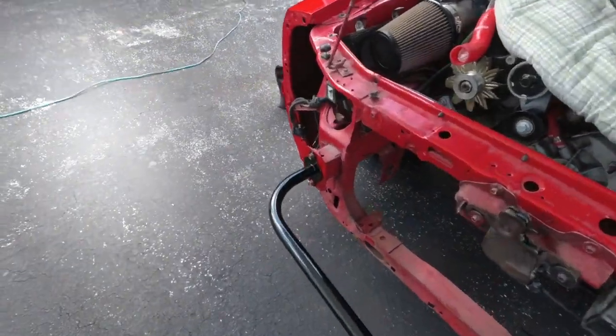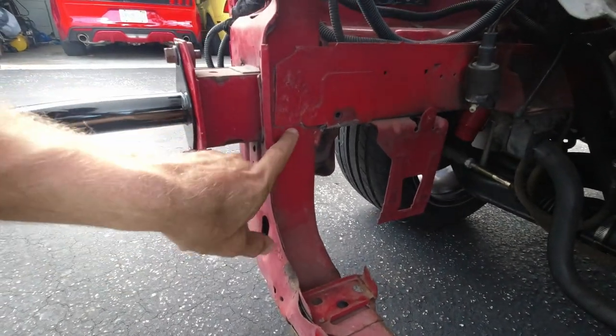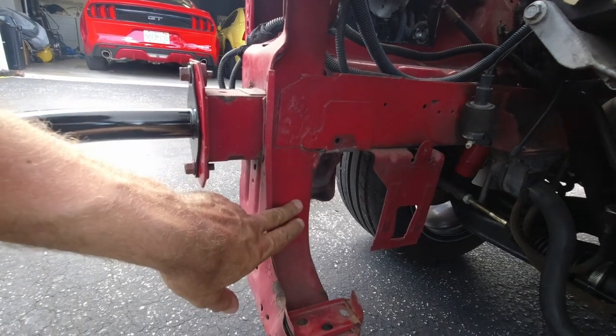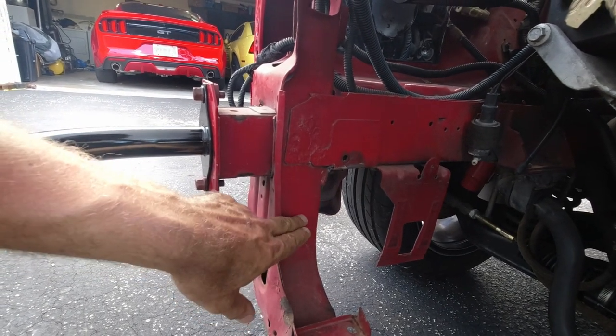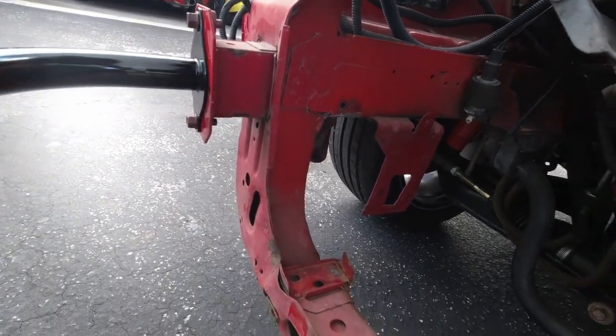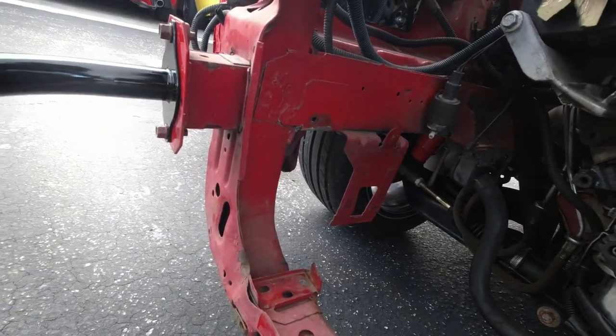As far as how far to cut on here, I'm not really 100% sure how far up I should cut. So likely what I'm going to do is cut a little bit lower and then test fit and work my way up. It's going to be a lot easier to take off additional material than it is to add more metal back on later.